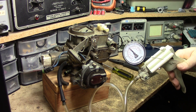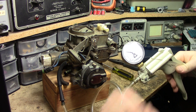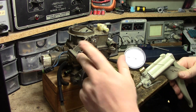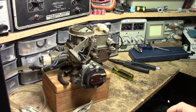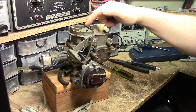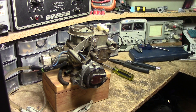You will apply 20 inches of mercury vacuum. If it starts leaking down, double-check all of your hoses. If it continues to leak down, your diaphragm is leaking — replace the diaphragm. Now, what you need to do is set the initial opening clearance right here. The idea is that if this is too far closed, it's going to be too rich, and if it's too far open, it's going to be too lean. It wants to be at an ideal position.